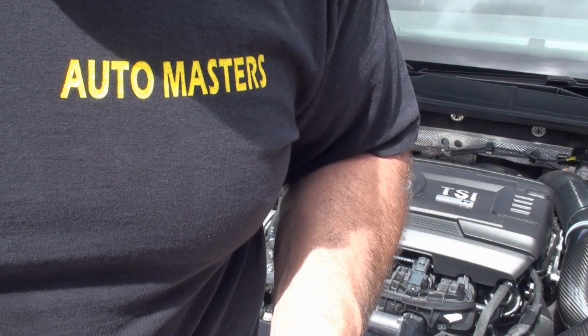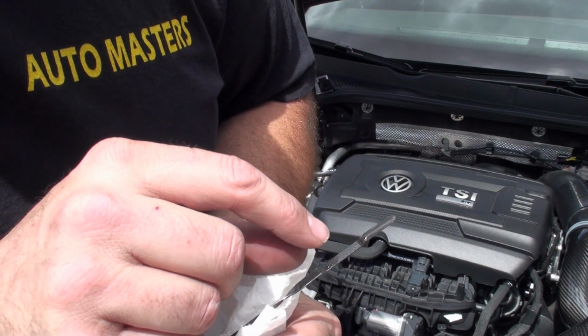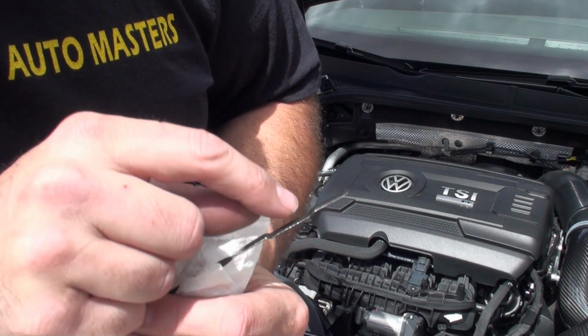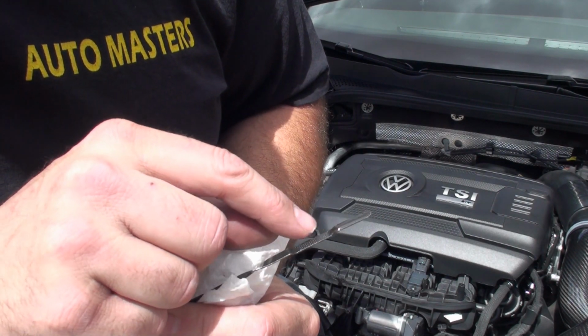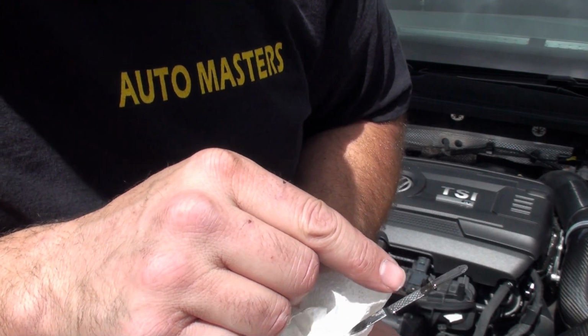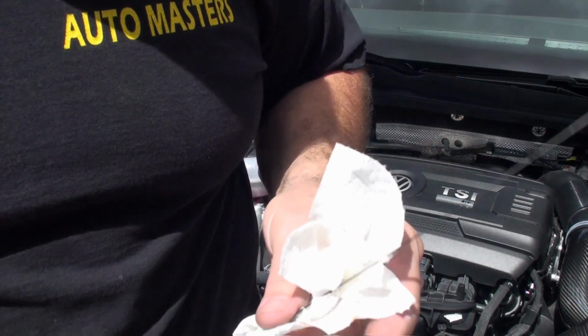All right, let's see where we're at. We're at the very bottom, it looks like. So it might be hard to tell in here, but the oil is going right here to this little bump or this little bend in the dipstick right here. So we need to add probably about another quart. Usually on most cars this whole area right here is about 1 quart, but not always. So check your owner's manual.